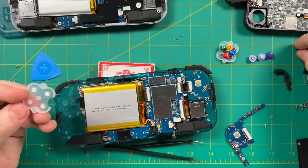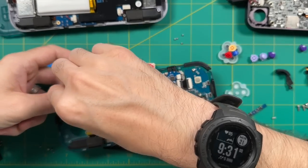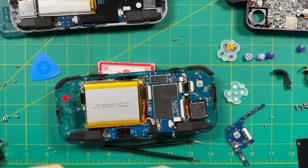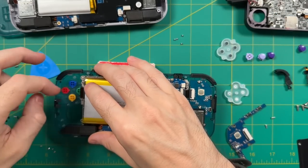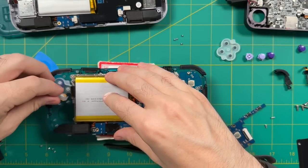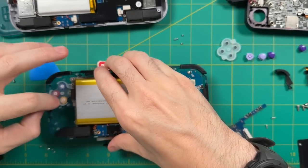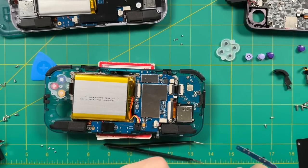This is what the membrane looks like after you've ripped out the buttons. Installing everything is actually fairly easy — just place your buttons in the correct spots. Each button has some little pieces of plastic on each end so they can only be placed in one certain way. Feel around to make sure you've placed them correctly. Once done, reapply the dome switch rubber membrane, making sure the rip part is facing the buttons and not facing you. There are two small plastic posts that will guide the rubber membrane into the correct position.